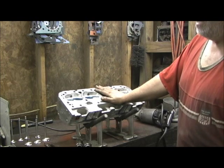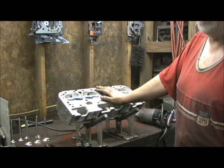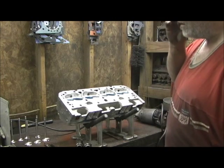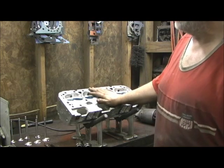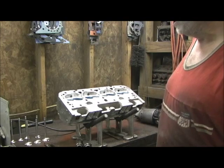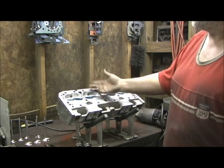I took the heads and carried them to two more independent places and tested them. It was kind of shocking to see the difference in numbers, which I think a lot of it comes down to calibration of the benches. When me and Jason flowed the heads, this is one I've done and Jason had a set of heads — they were 250 thousandths raised runner, where this right here was stock location.